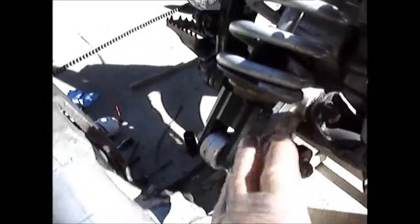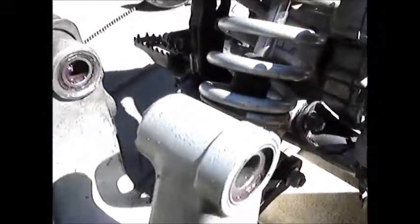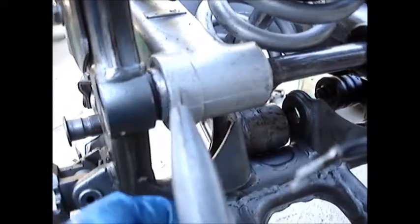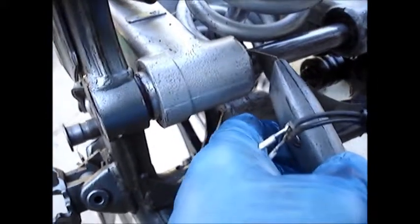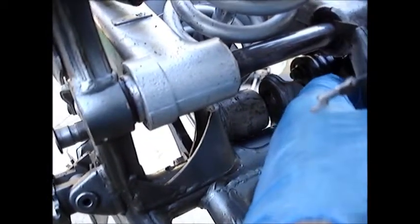Okay, so this is the configuration. And then we'll swing this up into place. Go up here, I guess. Nope. So we have a collar, and then there's a seal. Alright, and then there's this bearing, there's a seal. Then when we put the engine in, you'll see there's a gap that measures 2.2 in here. Then you have your engine. Then you've got this gap.